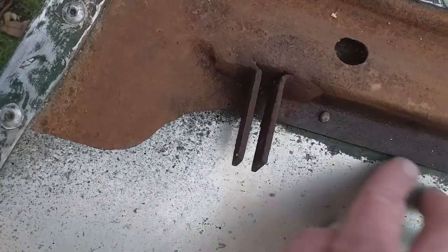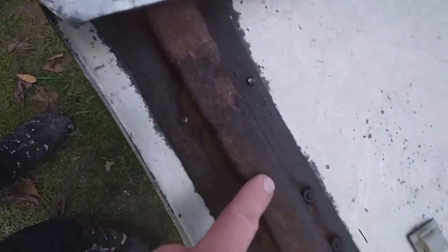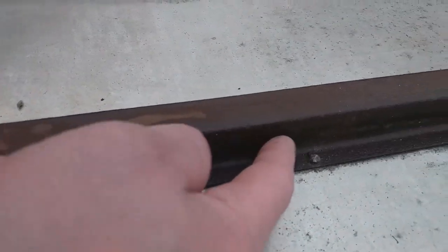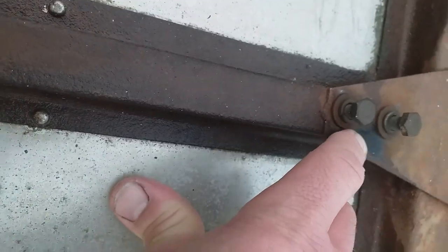One of the first things I've been doing is having a look at the underside of the bonnet, which had a lot of overspray of different colours. I think originally it was probably not painted because in the 60s they probably wouldn't have painted it if it didn't need to be. The underside of the tub and floor panels have all got this goldy lacquer appearance. I took it down to the lacquer. These ribs are going to be green as there's evidence of green paint, and these triangular bits are going to be black - there's evidence of original black paint.